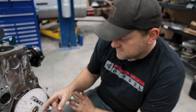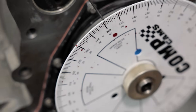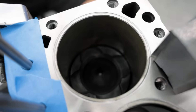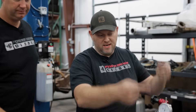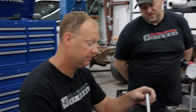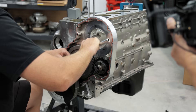You can see how far down the piston is in the bore at 100 degrees past TDC — that's where the piston is when the intake valve is fully open. He's putting on cut-off bolts with a low-profile head so they fit behind the cover, then tightening one or two of them down. We're really close to 101 degrees. With the adjustable gear setup we might be off by one or two degrees — we'll find out. The cam gear is now locked to the cam, which is on the crank, so as we spin the crank we can verify the position.